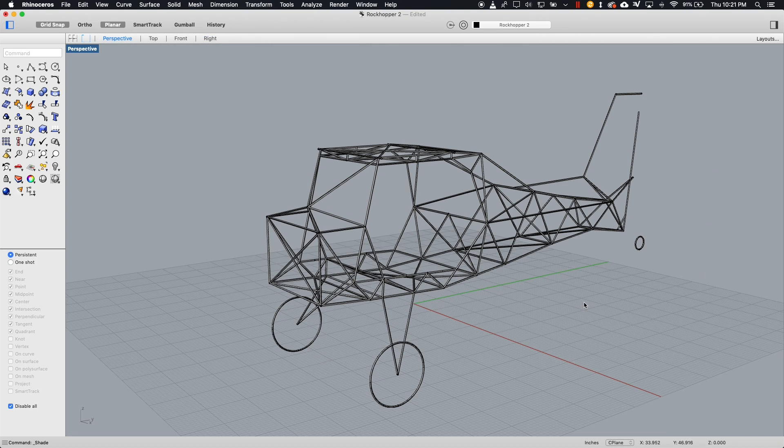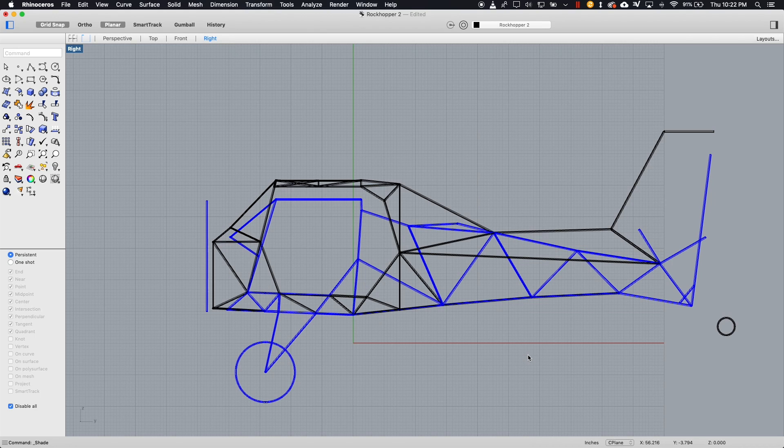So how did we solve that? Now this is about version 3, digitally speaking, of the airplane. We tried a couple of different versions moving different parts, and ultimately many of them were doable but too complicated and retained very little of the original structure. This particular version actually retains a fair bit. Let me overlay the original onto this - the blue structure you see is the original airplane, while the black is both our changes and the new version. Things are pretty substantially different in a few areas, most notably the cabin. The birdcage structure - which is what I call the upper section where the wing mounts - is up six inches, and this bulkhead right here doesn't even exist anymore. That's the whole way back over a foot aft of where it originally fell. This gives our cabin a lot more room and also allows us to sit further back in the airplane, which will help with the CG. You'll also notice that our firewall actually falls two inches short of the original firewall despite the changes.